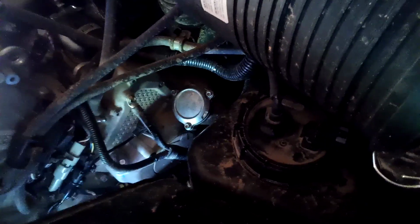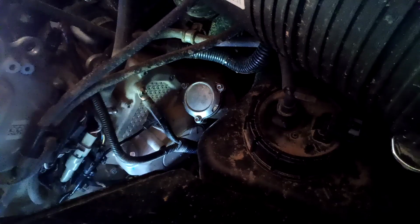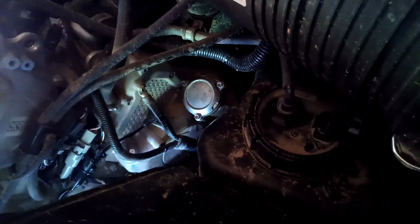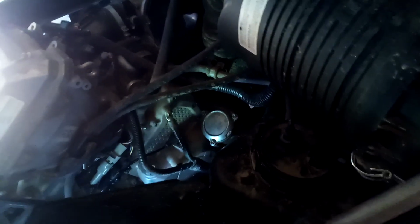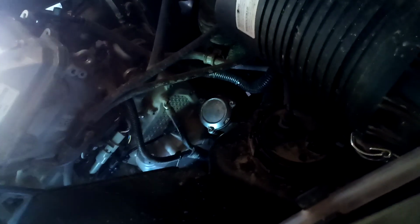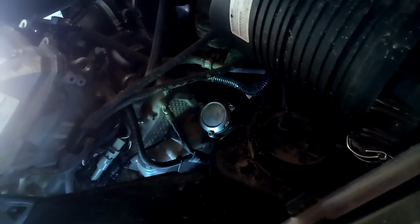While that was draining, I took off the oil filter. You can see it right in there. I didn't use the Torx to get that off of there. You could use a bigger Torx bit, but I actually used an 8 millimeter socket to get those 3 off of there. Came off really easy. I got that off of there, pulled the filter out while that was still all draining, cleaned the top of it off really well, there's a gasket that came in the kit that goes on the oil filter cap. I replaced that, replaced the washer on the drain plug, cleaned that off really well.